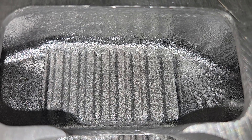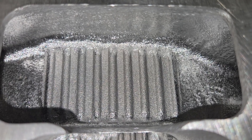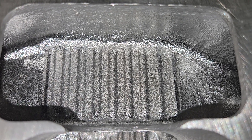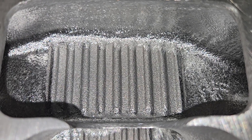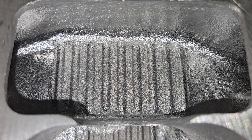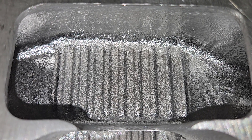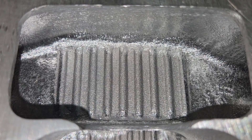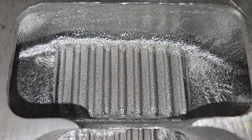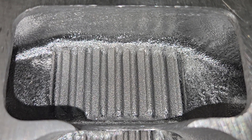The small block Chrysler is going to be a stroker with 675 heads - the same heads I did for DV's Mission Impossible engine - but we're going to go a bit further. We're allowed to put bigger valves in them. I think I got to about 230 CFM out of those heads with a 1.78 valve, so with bigger valves it should be better. We're going to use magnum-style valves and smaller magnum-style guides. It's not a super high-dollar project so we're using parts we can get readily at reasonable cost.